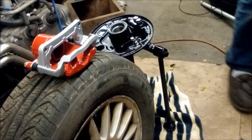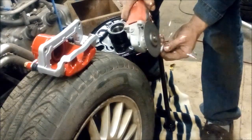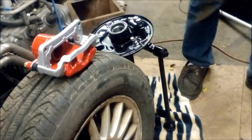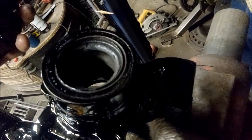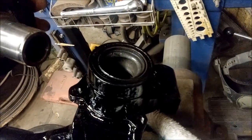We've got a thread that has garbage in it — let's take a mini grinder and clean out the crap. I need this piece to go back in that hole right there and I got a little overspray in there. So I'm going to take a Brillo pad and spin it out with a drill a little bit.